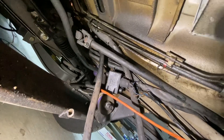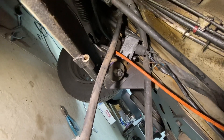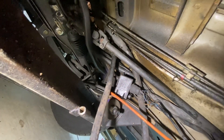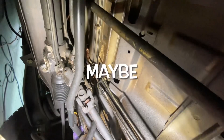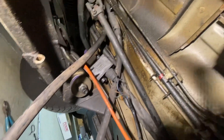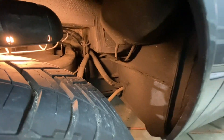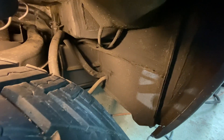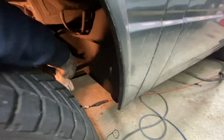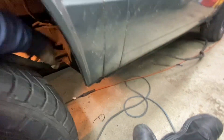Here is my conundrum: they've got a big bend on that end over there and the same with this one. I was hoping to push these back, but I think we're going to have to pull them all the way through. We're going to do the smaller hose first — pulling it up and out. This way there'll be more room to get the big hose through that little oval-shaped hole that's up there. This is really crazy how this is run. I've got oil dripping out of this one all over the place — we have to put some rag on that to cover it up. It's tight through that oval-shaped hole over there.